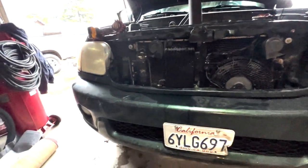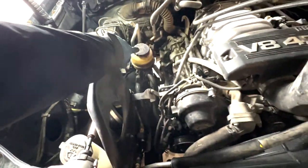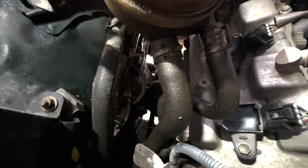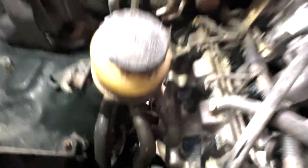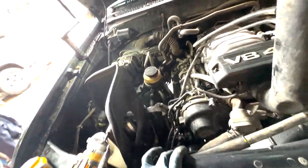You actually need to take the power steering bolts out — should've remembered that. The pump is now loose; I took off this reservoir. See how those clamps are really greasy? I might put on some screw-on clamps, or band-style clamps where you can tighten them. Those tension clamps get loose over time, causing a slight leak.